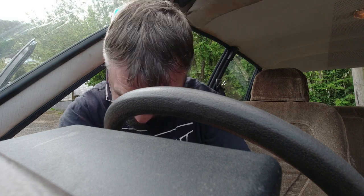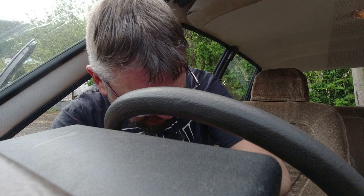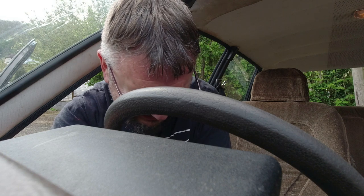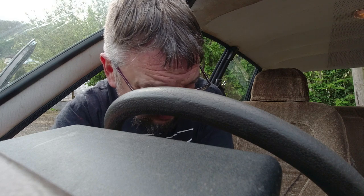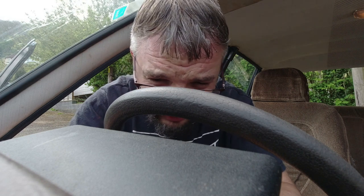It is deliciously very, very French. I'm just angry. My solution is to fit a cable tie loosely around the speedo cable so I can reach the cable tie quite easily and then shove the cable onto the back of the speedometer. Let's see if that works. This is uncomfortable. If you always want to know what your sex face looks like, try working on a Citroën and recording yourself. Oh, I just want to get my elbow in — oh ow. Why couldn't they fit slightly larger speakers? Why couldn't I have bought something that wasn't a bloody Citroën?